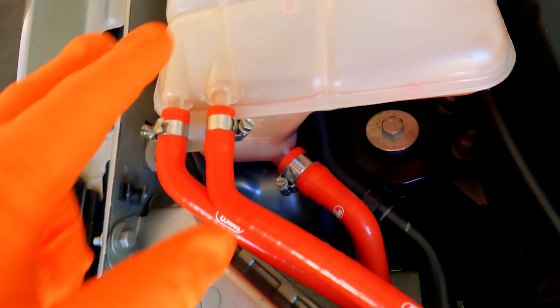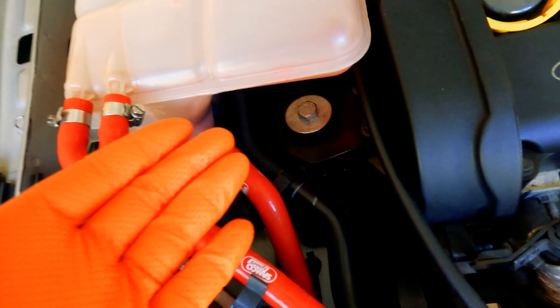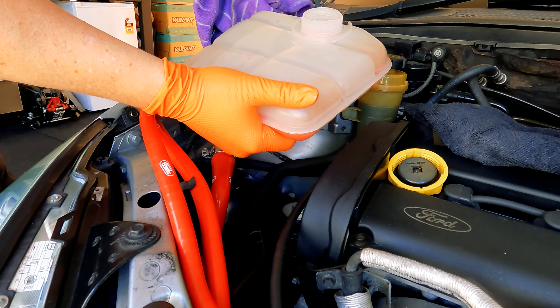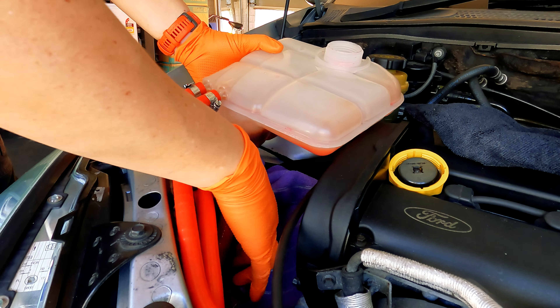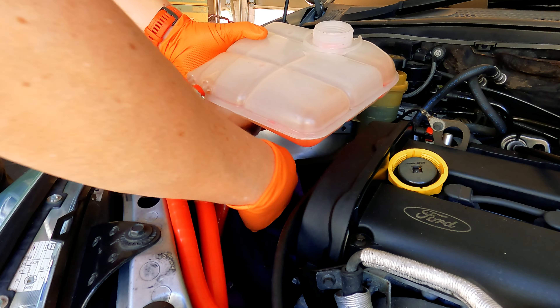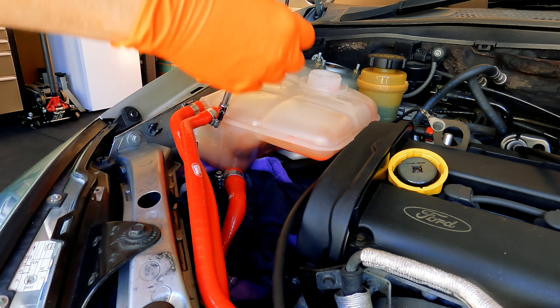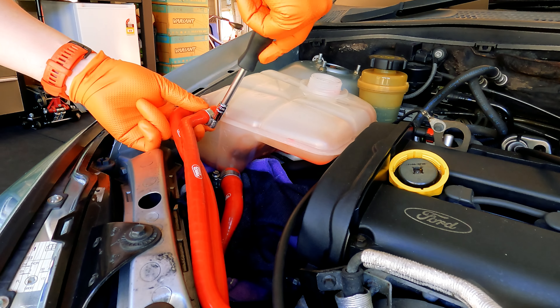What we've got to do now is take this bottle out. There's a little bit of coolant down the bottom, but it's not much at all — you're going to lose a little bit but not that much. Wipe things up while you're at it. Just try to catch some of the stuff that's going to come out — there will be some. We just want to undo all the hoses, with a towel underneath to catch any fluid.